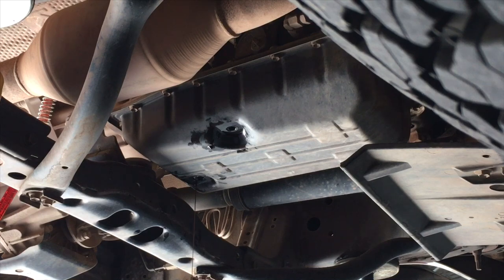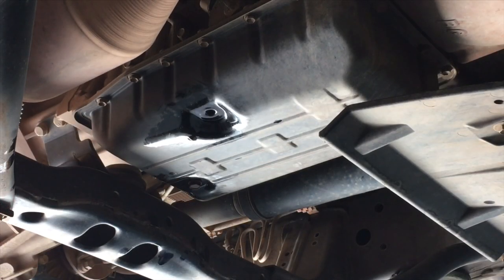So we're going to repeat this process a few times. This is the final fill — we've got new washers on our drain plugs and we've topped it up plus a little bit extra. The car is started and we're looking at the transmission temperature. Currently on about 35 degrees and we're just slowly topping it up. Any time soon it's going to start overflowing — there it is, and you can see the oil is quite clean, which is what we want.